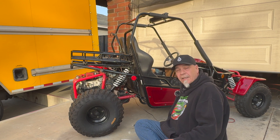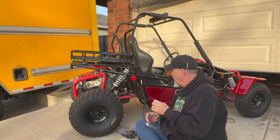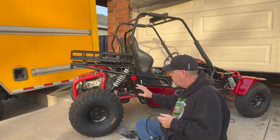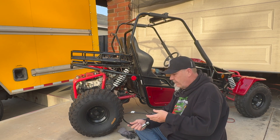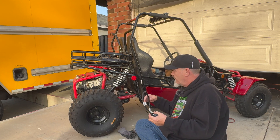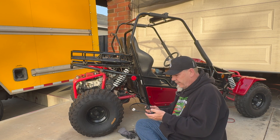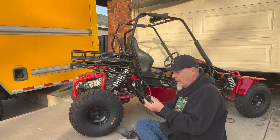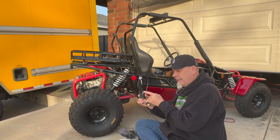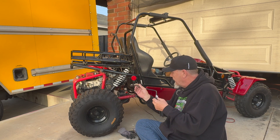What's going on YouTube, Dorito here. Today we're going to change out the ignition coil on the Taotao Baja 200. It's a GY6 169cc engine — basically the same thing on every one of your GY6 engines, whether it be a Hammerhead, Trail Master, Kymco, or any other. I'm going to show you guys how to change out the coil. It's basically going to be two 8mm bolts, and you're going to have to cut a zip tie and unplug the connector.